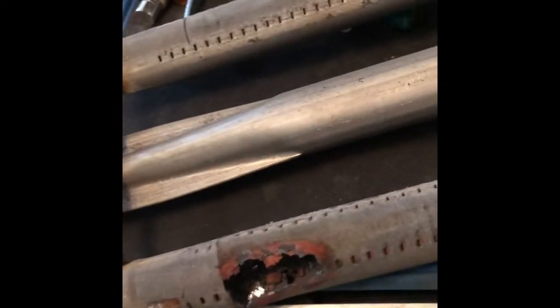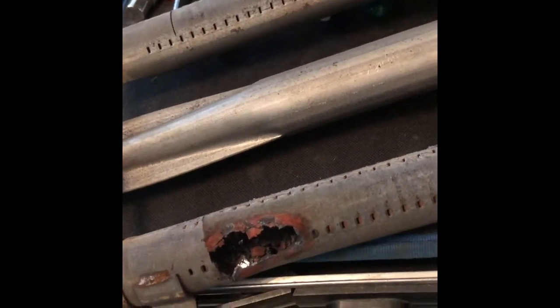The Venturi assembly is pretty easy to remove. Just lift it up near the back, lift it away from you first, and then you can pull it right out. It's not connected by any fasteners — it's actually just sitting in there. So we've got the old Venturi out. You can see that pretty big hole there — that was just letting a lot of gas come out early, creating a big flame.